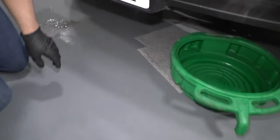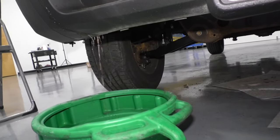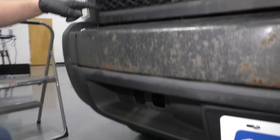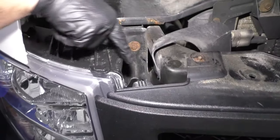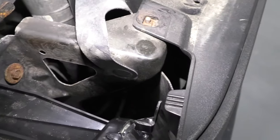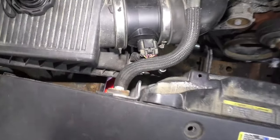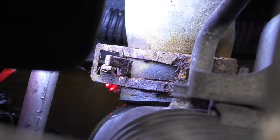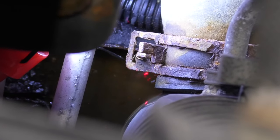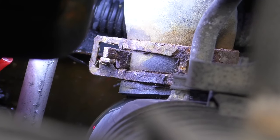I'm going to take a look under here. It's actually leaking over here. I can follow the drip — if you look down there, it's actually spilling right out of the base of the radiator right there. It looks like the lower radiator hose area is where it's leaking. With a little more than 7 PSI in there, if I look at the base of the radiator, the coolant's coming out right here, right where the hose goes into the radiator — the lower radiator hose.